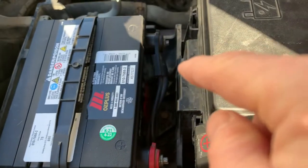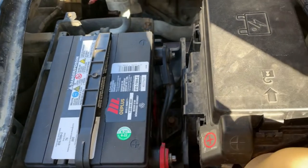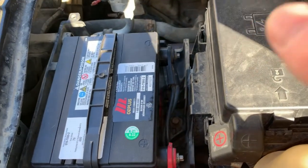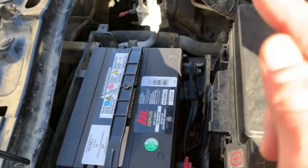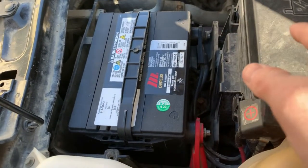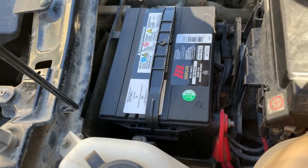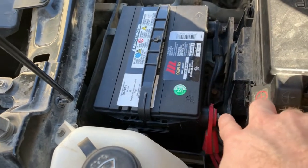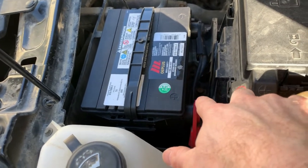Apparently they're saying this battery is good, but I think they're full of it. Because if it was good, we wouldn't have a problem starting her up right about now. The alternator is good because we had a mechanic out here test it, and it's got its proper amperage — it's pumping it out, it was charging the battery when it was running. That's why we were thinking it might be these terminals. So I'm going to change them out, put the charger on, and hopefully she works from here on out. Let's try it.